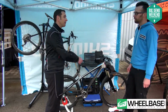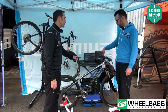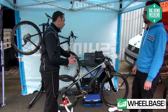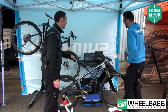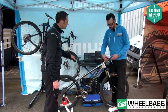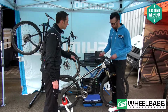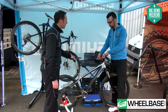And you can adjust that from the front of the bike? Well, you would just have your Fox electronic switch on this side, your Shimano XTR switch on this side, all your gears there, all your suspension settings there. Does it use the same batteries as the road then? It does indeed, and with the particular system that we're running, you notice that there's no exposed wire, so the wire runs back through the bar into the back of the stem, and we've hidden the battery inside the steerer tube here, so you've just got one wire coming to the rear.